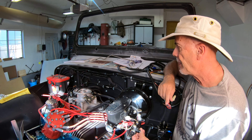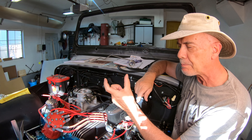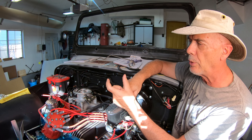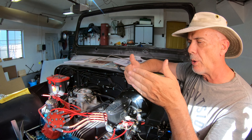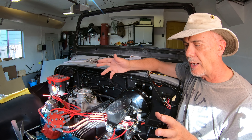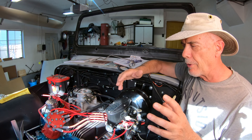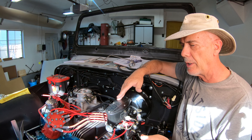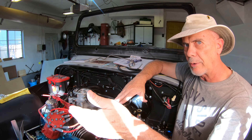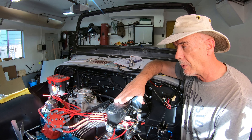I have got the fan back on. On the old fan there was a spacer — about two to two-and-a-half inches — that went between the old pulley and the fan so the fan sits closer to the radiator. I don't know yet what my radiator configuration is going to be, because I'm planning on putting in as big a radiator as I can get — I've always hated how hot these things run. Between the new radiator and the shroud that comes with it, I'm not sure what the fan spacing will need to be, so I didn't put that spacer in but may need to revisit it.